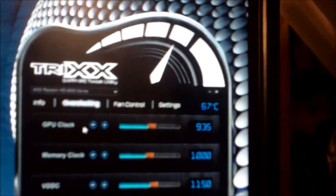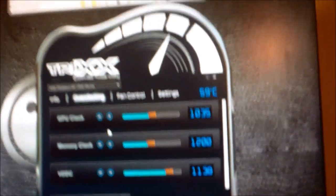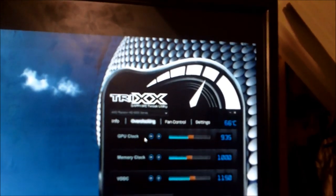Here's an example of how much cooler this case is running than the other case over here — that one is 67°C, and the cards in this PVC case are running at 59°C. I think it's key to the open design. That other case actually has extra fans, but it's still running hotter than the PVC case I made. Thank you.